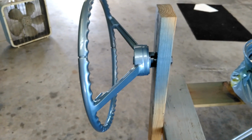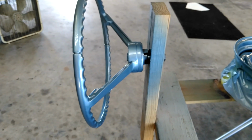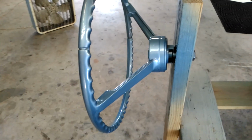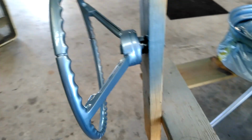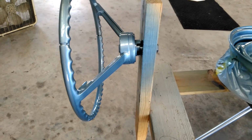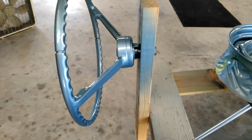Like I say, I could have probably taken another hour or 2 and really sanded that better. I mean, that's base on top of 320, Shop Line on top of 320, on top of some putty that I bought at AutoZone, and sanded for 10 minutes. So that's about what I expected. If I would have taken the extra time and gone through the grits and topped it with 400 on top of some 2K high build, spent a day doing it, I could have got that perfect. But that's the back of the steering wheel.